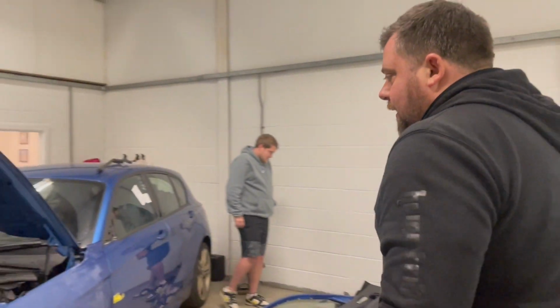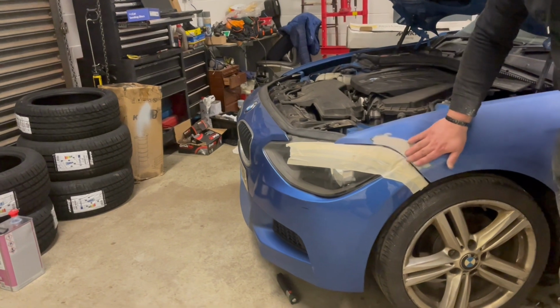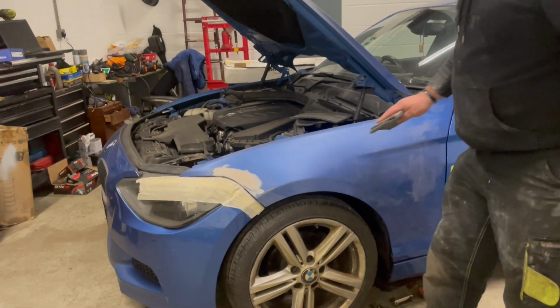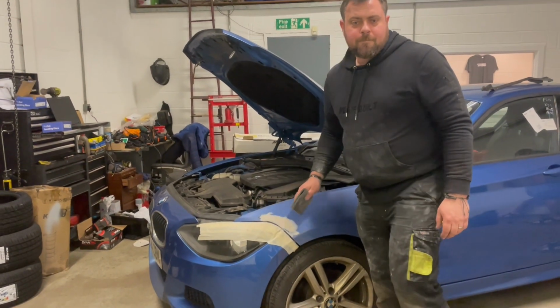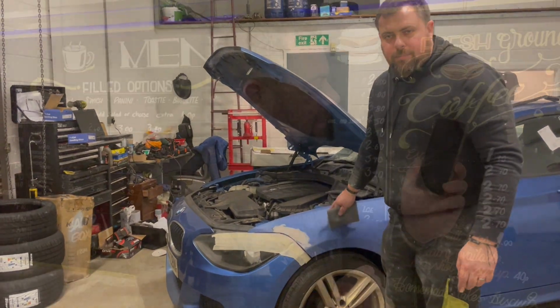The BMW wing, I've also got that fixed, and we've done a skimmy filler on that. Just rubbing down the rest of it now, ready for a bit of filler primer, and hopefully we can get this one painted tonight and this one almost ready to paint. So I'm going to try doing a bumper blend like the good old Chops Garage rattle can jobs, and I got myself a can of the blending spray, whatever it's called, fade out thinners.